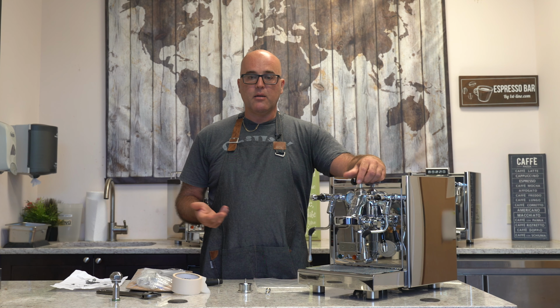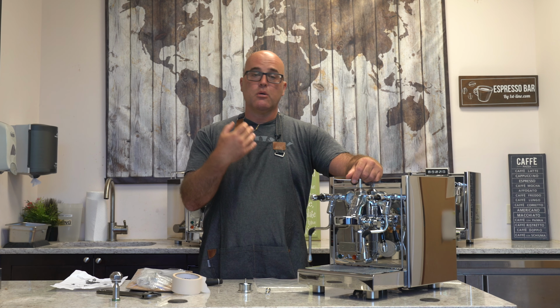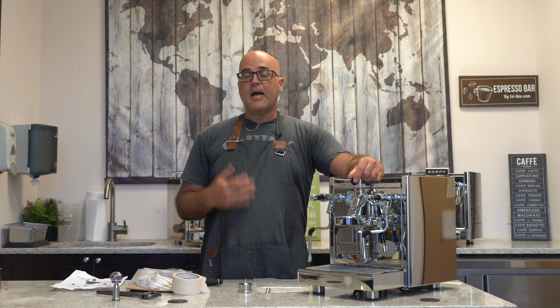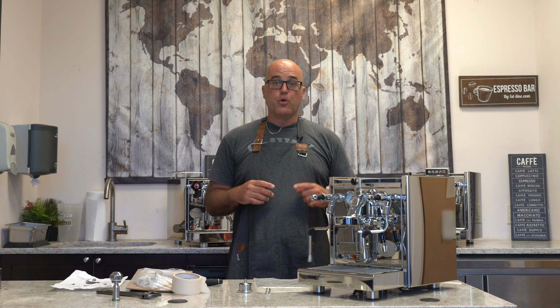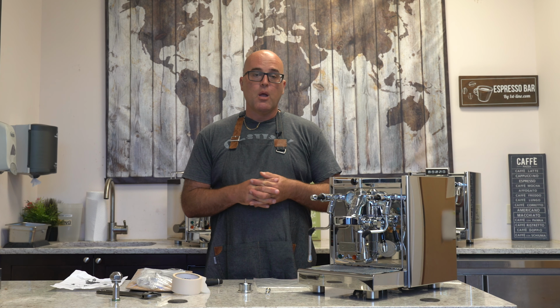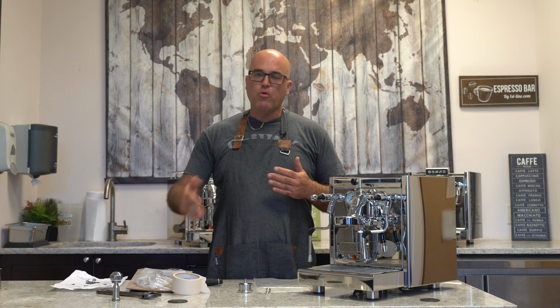The entire purpose, again, for this device was to bring the flow down, bring the pressure hitting the puck downwards, because that's where you can hit some of the sweet spots or differentiate the flavors coming out of your espresso blend. And this is why back when I gave another company this idea on an E61 back in December 2015, from my experience of trying different coffees at the same grind setting, same amount of dosage, but trying at different pump pressures, I started tasting differences in the espresso.